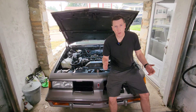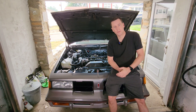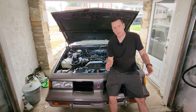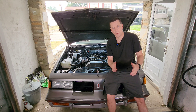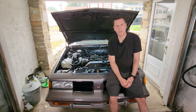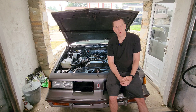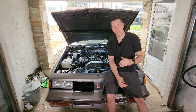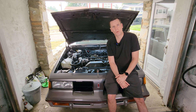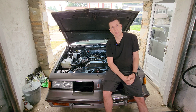And that's it — we're done. All we have to do now is turn the idle back down, uncap and reattach all those lines that we removed, and put the air cleaner back on. By taking the engine computer totally out of the equation, it didn't mess with the timing at all or change the way the motor ran. Now we've got our base timing set at 20 degrees, right where it should be. This way, when the engine computer makes adjustments as we're driving, it has a proper baseline to work from. Hope you found this video helpful — see you in the next one.